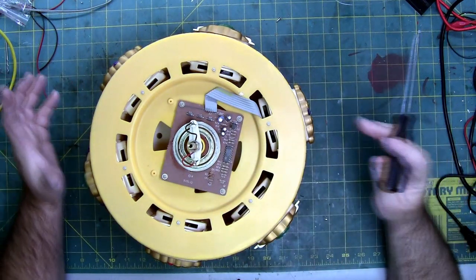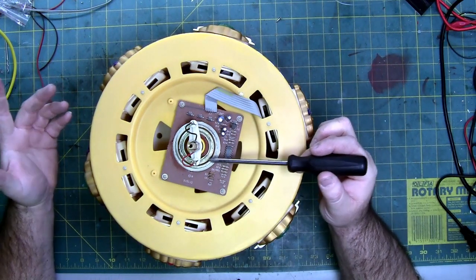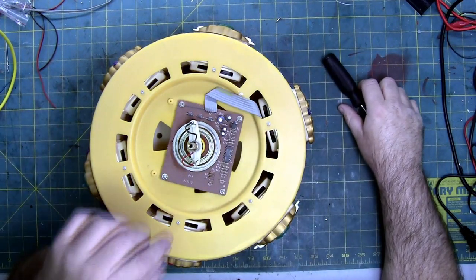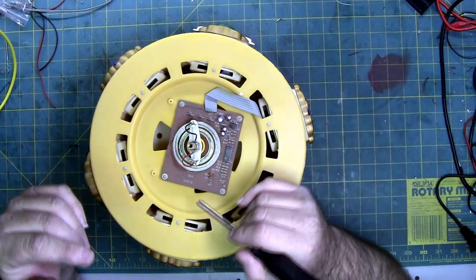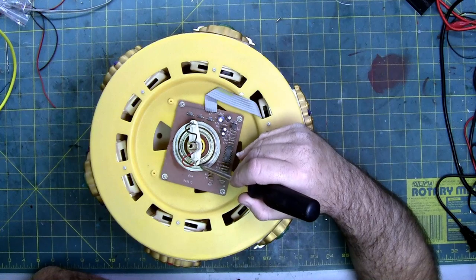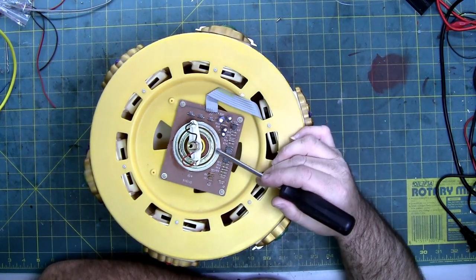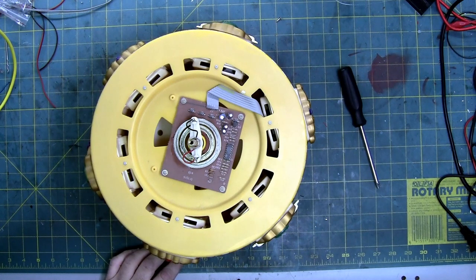Here is the rotor for the lights — and this rotor assembly is really gouged up and very dirty. Because this rotates and we need to send power, they use a rotor board. I call it that because when I was a kid they called these rotors on bicycles and scooters, which allows you to spin the handlebars without severing the brake lines. On rotating circuitry you have two contacts that spin — very similar to the steering column in your car that allows the horn to work. This one is really gouged, with shiny silver spots where the spring-loaded contacts are pushing in.